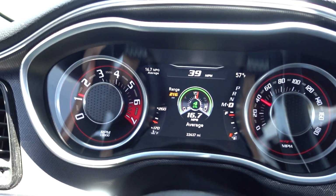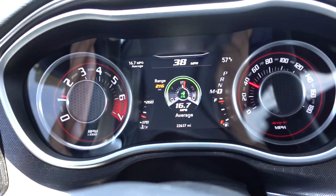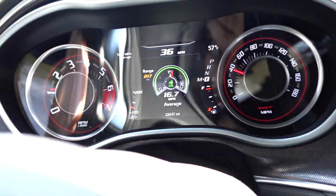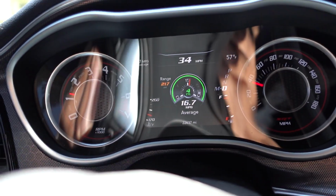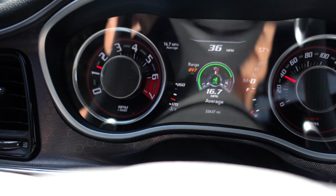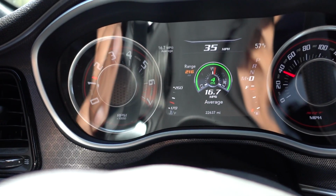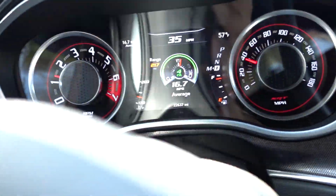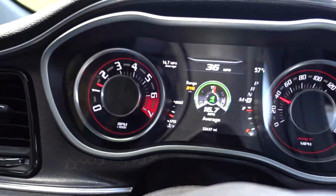But anyway, according to the computer and the interwebs, a P1217 would be active exhaust 1, which means that would be on the left-hand side. So I think that's the one we're going to pull apart here, after we let this thing cool down a little bit so I don't burn my fingers, and see if that's actually got a broken spring or something. Apparently there's a technical service bulletin that says that spring in particular has been known to be weak and that there is a replacement number. So when you see it next, unless I can get this code to come back up, I'm going to go ahead and give that a little bit of an inspection. So I'll see you when we get back.